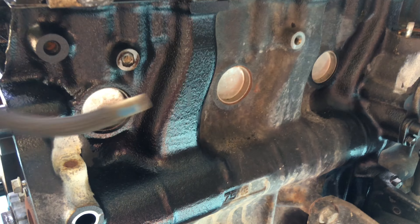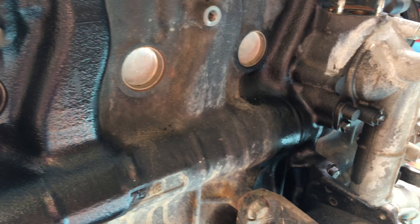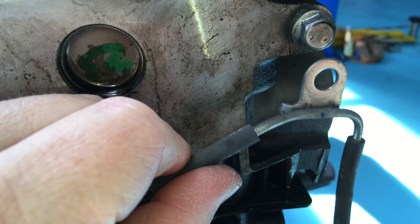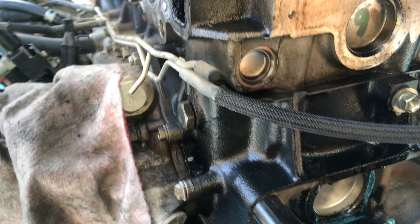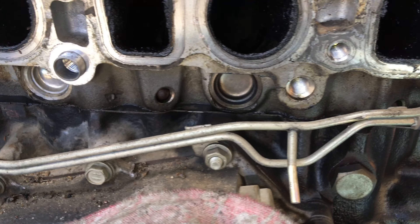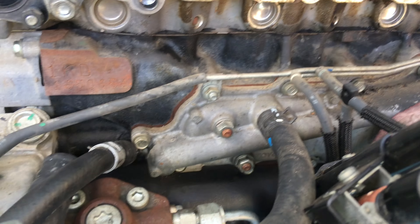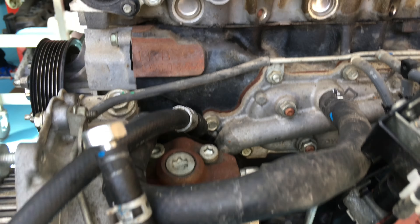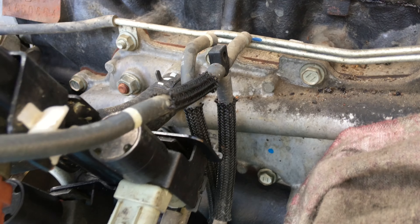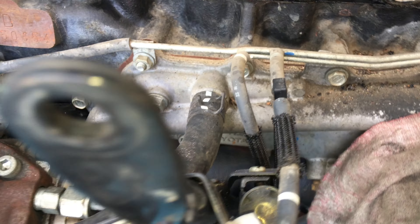There is a vacuum line that runs all the way around - this one here - to this side, for the engine mount. You can see the bolt for it up on the back of the head there. Comes all the way around. There's a few 10 mils there on top of the oil cooler. Just showing you - following it through if anybody's working on one of these. It comes back around here and then of course it splits off up here. At least you can look at this footage if you need to.